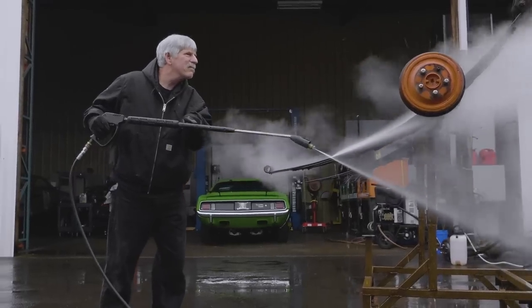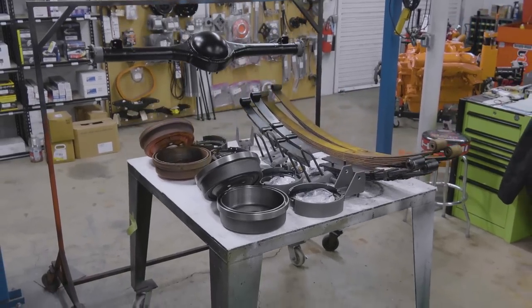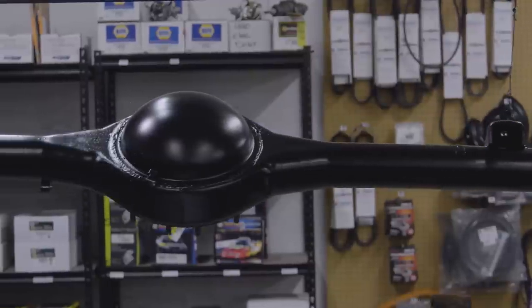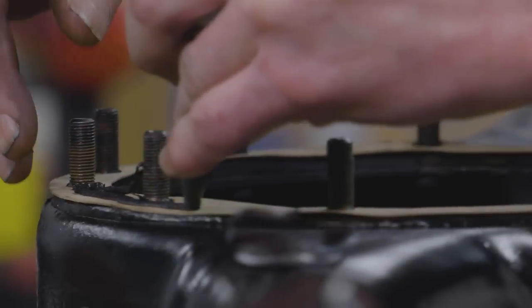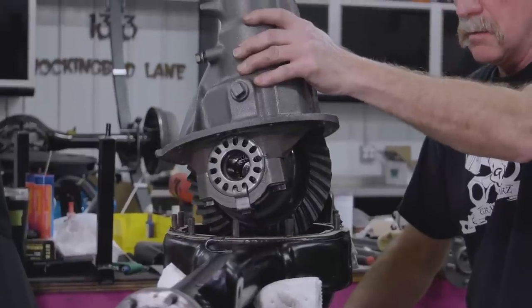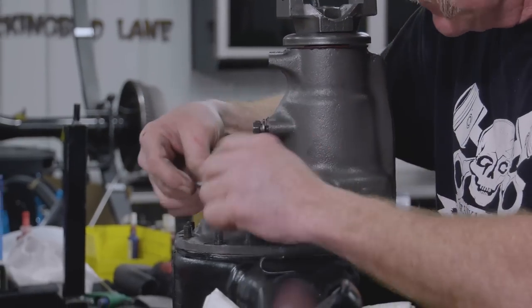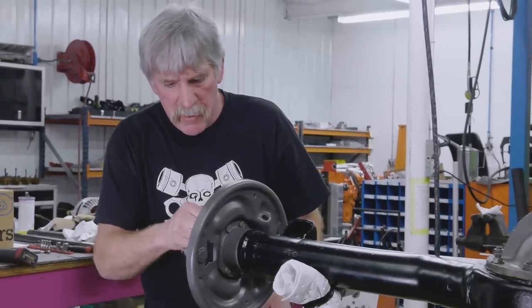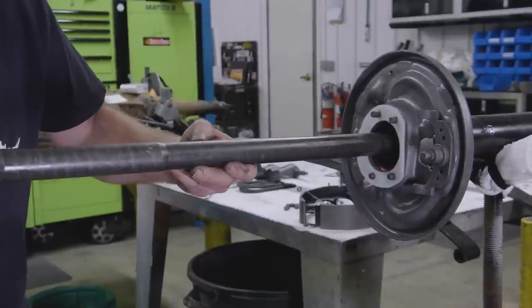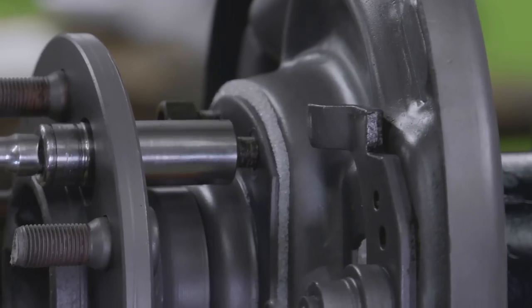The car had an eight-and-three-quarter rear end. One of my jobs is to completely dismantle, restore, and reassemble the entire rear end and leaf springs. Part of the process is to water-blast the components, clean them, and then satin clear. Will paints the housing, and then I reassemble everything according to the way it came apart. All I have to do is put the third member back in with a new fresh gasket and sealer, and that'll be ready to go. I replaced the axle tags with new ones from Dante's Mopar. This car is optioned with front discs, so I'm going to put 10-inch rear drums on it. After the backing plates are installed, I'll put the axles in with new bearings. The axle flanges hold the axles, new bearings, and backing plates all in place in the three-quarter housing.